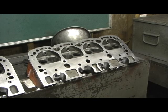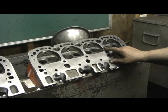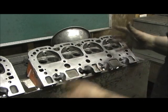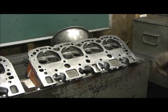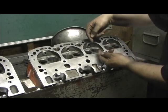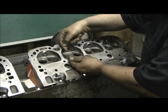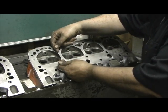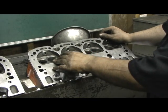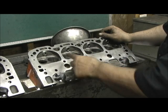What I'm going to do now is I'm getting ready to scribe the combustion chamber. I don't fully port the chamber, but it had 194 valves in it, so on the intake area, I'm going to lay the blue stripe standard 350 gasket on it, the dowel pins, dock them, and scribe the line on the chamber, because this half of the combustion chamber right here is what needs the attention. The exhaust — not that it flows super well — but there's more of a problem on the Chevrolet head of getting it in than getting it out.